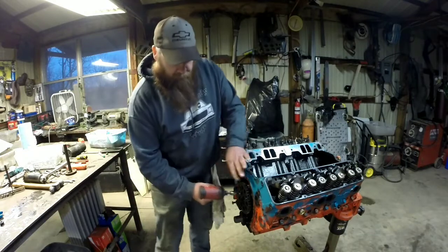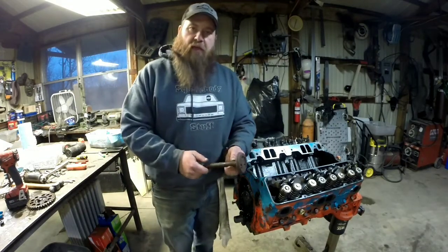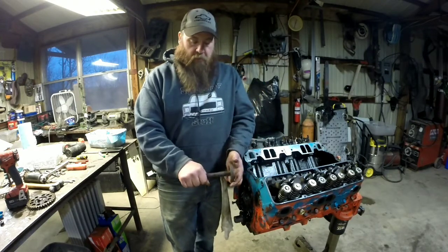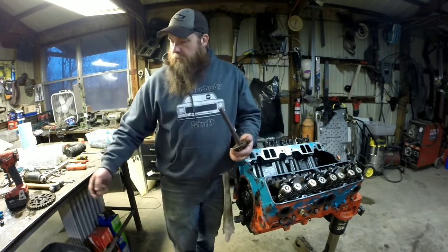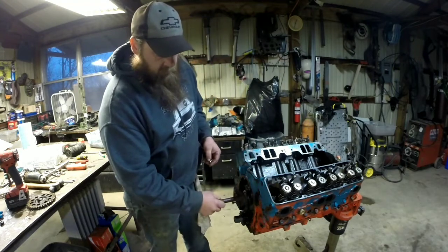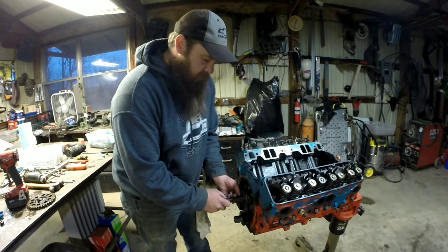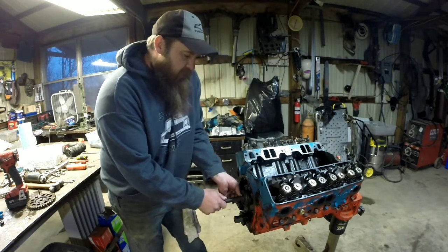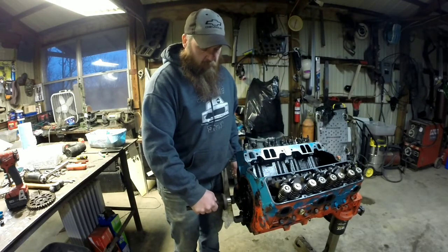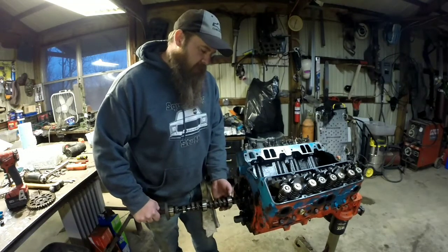Now I'll pull this gear off and I'll show you a tool that I made. You can buy these already made. It's just the same pattern as your camshaft with the handle on it. I made this a long time ago — it's just an old camshaft sprocket that I cut down on a lathe, welded a rod into it. There's a bolt on there, and it's just got to be finger tight, it ain't got to be super tight. But this gives you a little more leverage to actually do it pretty much one-handed. It's better to use two hands to support the camshaft a little bit so you don't beat the bearings up too much.